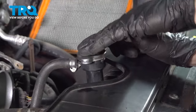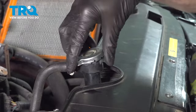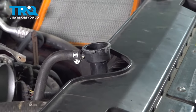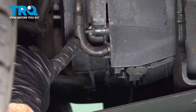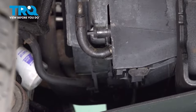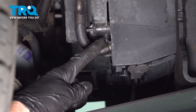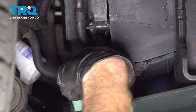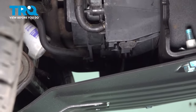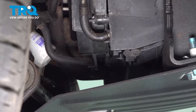Now let's continue on by getting ready to open up the top of the radiator. Make sure it's cool to the touch. Press it down, turn it counterclockwise. Now we can make our way underneath the passenger side front of the vehicle to start draining the coolant. You're going to be looking for the lower part of the radiator. You can see that it has the drain right on the passenger side. Make sure that you have a way to divert that coolant down into a collection bucket. You can put a hose on there and make sure that it goes into a collection bucket so you can recycle it properly.